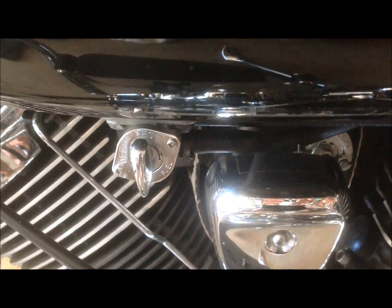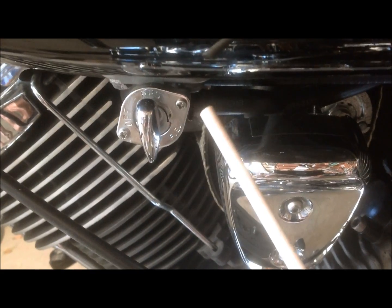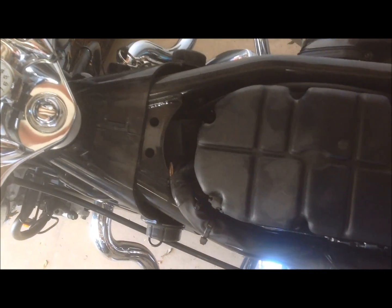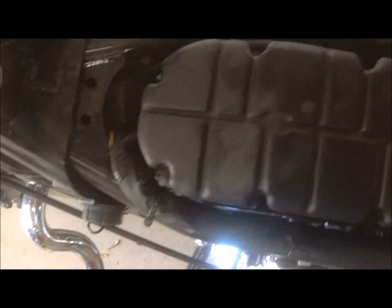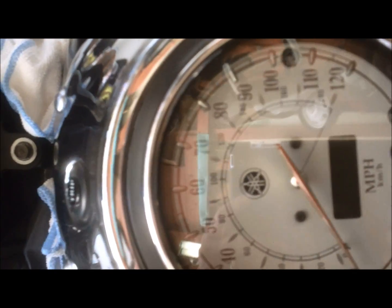Before moving the gas tank, I'm going to turn my valve to off, and I'm going to remove this hose. It'll give me more freedom and movement for the tank itself. So what I've done is lifted up the rear and pulled the gas tank backwards, and it pulls right off its round supports. There's one. And I've set the tank back. Releasing that fuel hose allowed me to move it all the way back here. So I still got some hose and wire attached to it, but it's got enough flexibility to move back this far because I need access to the coil.